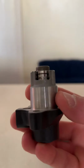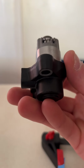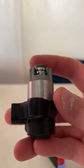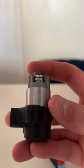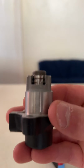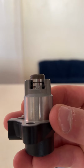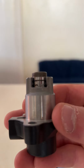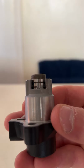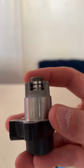As you will see, the tensioner is now in the locked position. Now if we apply pressure on the top of the piston, the tensioner will release itself and be in the unlocked position again. This is the way you need to install it in the engine. According to the manufacturer's repair manual, once you install this in the engine, you need to rotate it counterclockwise to be able to apply the pressure. We'll see how it goes in the next video.